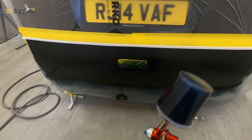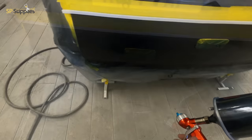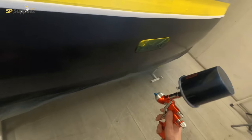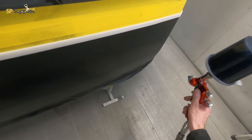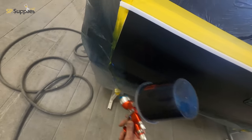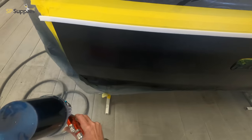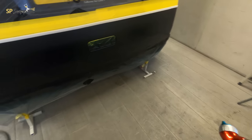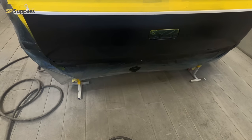A colour like this covers really well — I've already done both bumpers on this van so I know that. I'm giving it a little extra pass over the bottom of the door where the issues have been, then a very light fade out across the top, with a flick around to get an even metallic lay down on the rest of the paint. It is quite a coarse metallic, so we want that last coat to be a drop coat as well as a finishing blend coat.